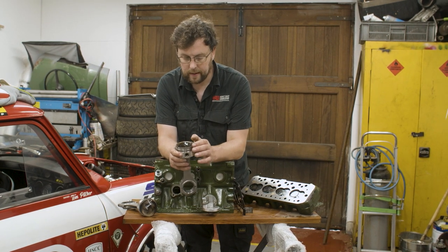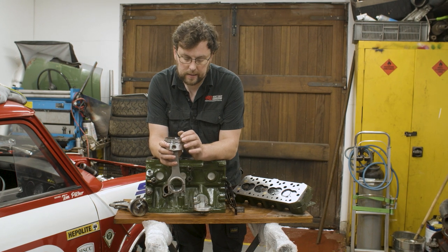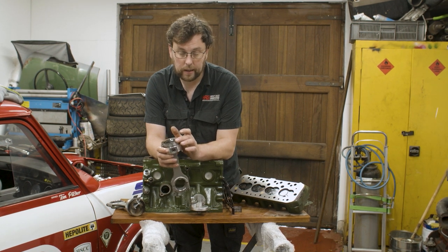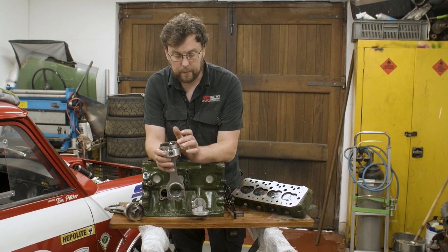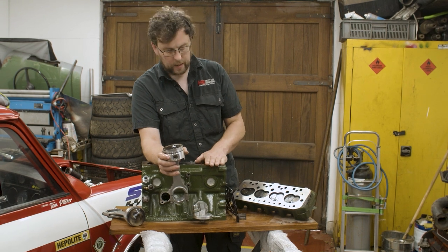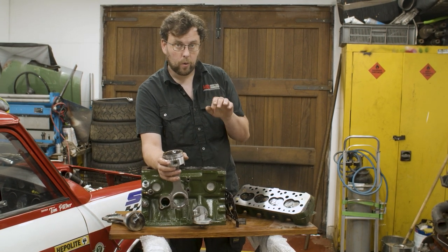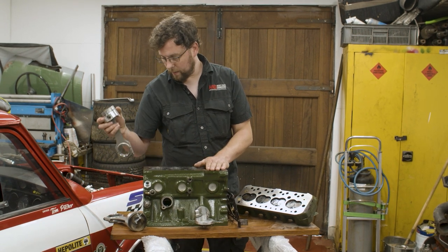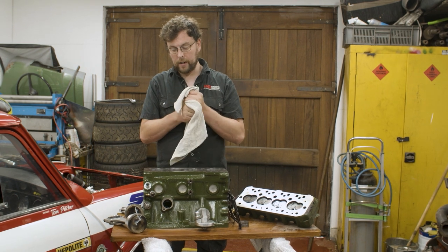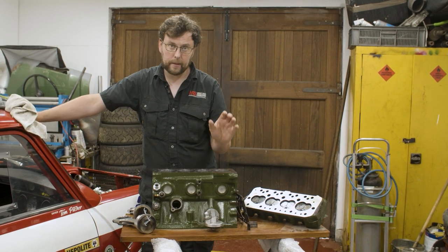He said if you're going to skim the top of these pistons, check the actual finish of them in the first place. These have a very slight radius rolled on the edge, done with maybe 300 to 500 grit sandpaper just barely rolled over the edge — so we're going to replicate that. We'll put these pistons back in the motor with the crankshaft, bring them up to top dead centre and measure how much they're sticking out of the bore. Interestingly, when I went back and measured before stripping the engine, these pistons were sitting near as damn it flush with the top of the block.